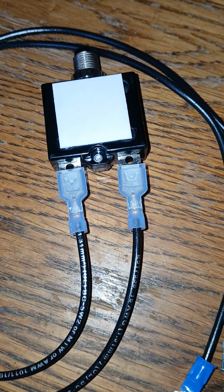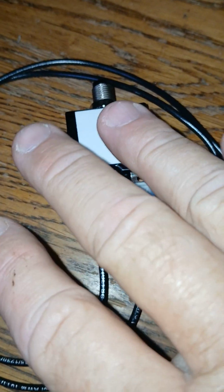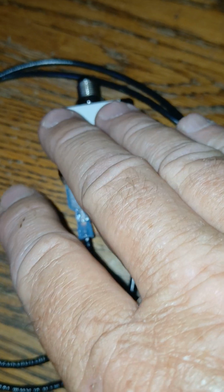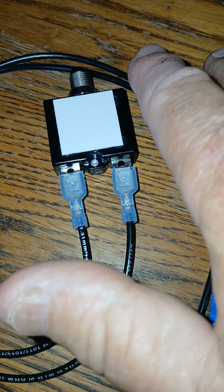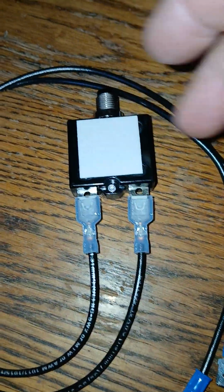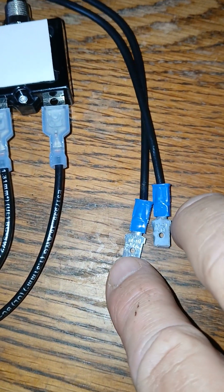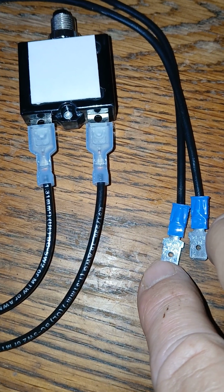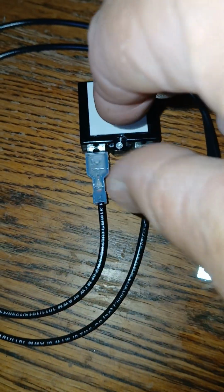there is another alternative route one could take. They could get a tool, something like this, and instead of having the car fuse that keeps blowing, and you keep replacing the fuse, instead this is a resettable fuse. Say, for instance, these connectors would go into the spade connector on the board where the fuse would go. So you would pull the fuse out and simply plug these in with the system off, I'm assuming,